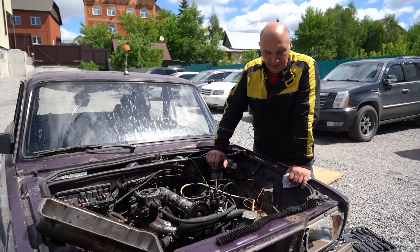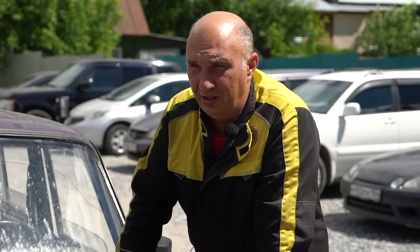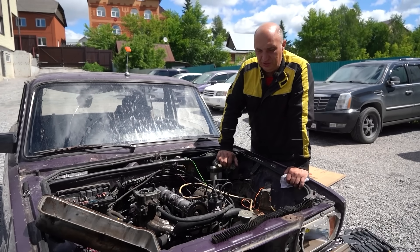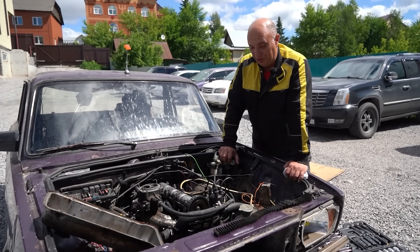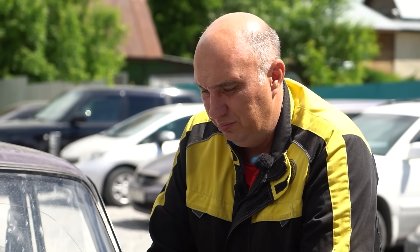And there you have it — it didn't take long at all for everything to get flushed out. Though I should mention there is one slight issue. When using something this aggressive to flush the engine, a clogged filter is going to result in decreased oil pressure. Not to mention the oil pickup might get clogged, which is going to reduce the pressure even further. So I suggest we remove the oil pan and see what condition the oil pickup is in — check to see whether there's any buildup on the strainer. Given how fast the residue started to come off, the pickup very well might have gotten clogged, and that's never a good thing.